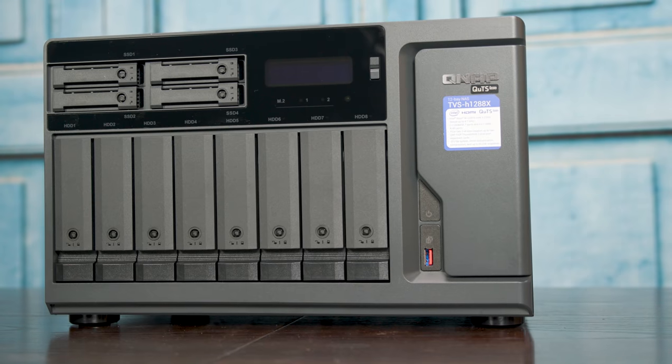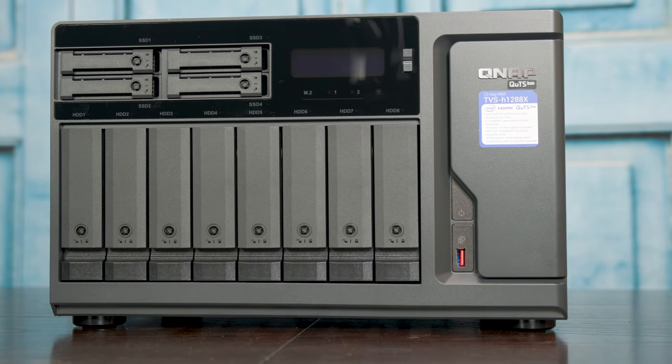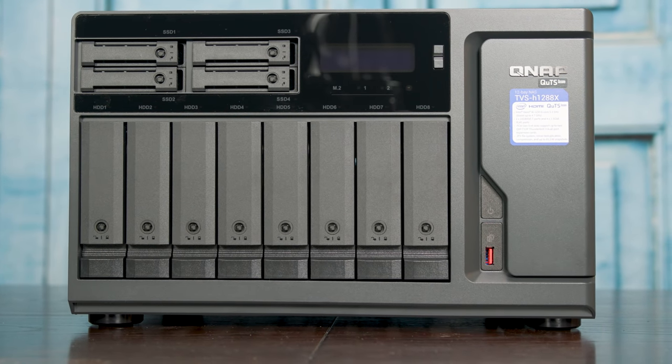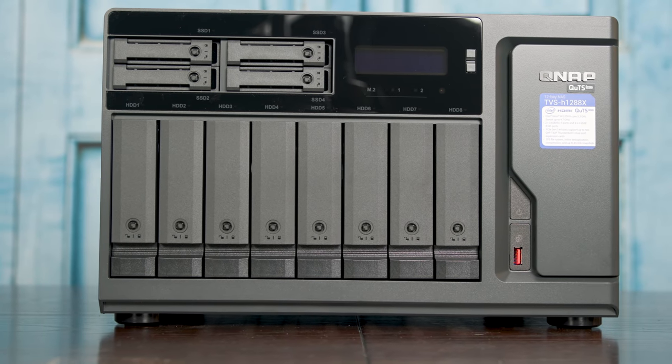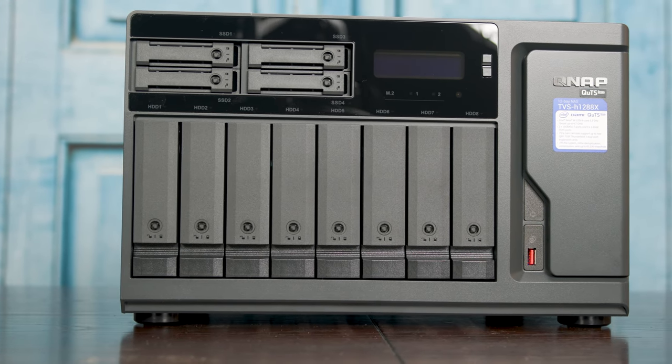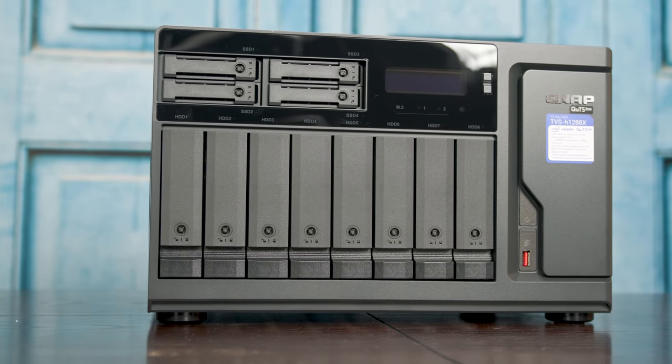There are a total of eight three-and-a-half-inch hard drive bays, but there are four two-and-a-half-inch bays, and that's why you get the 12-bay solution. But that's a little misleading because there are also two M.2 NVMe bays inside — they're just not hot-swappable. I think that people looking for an 8-bay NAS might miss this one because they'll say, 'I'm looking for an 8-bay NAS and that's a 12-bay,' but really it's eight three-and-a-half-inch bays. Then there's also the SATA two-and-a-half-inch bay array and the internal bays, so maybe there are like 14 drives total.